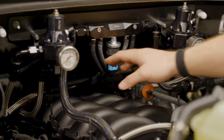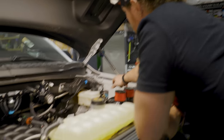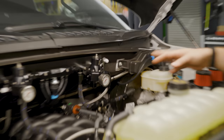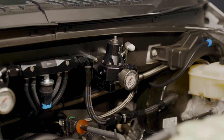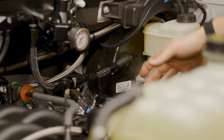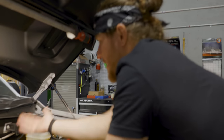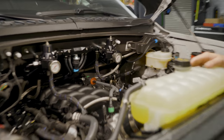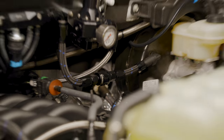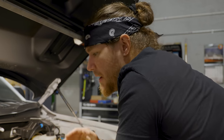On our vacuum block, we're coming out through a 10AN feed into here, which feeds all our reference points. We've got one hidden over here for a dyno reference, a couple feeding our boost solenoid, and another feeding some other miscellaneous vacuum lines. Coming out of the other side it slopes back down, and since we have a brake booster you can't pressurize that can too much without issues. So we have a vibrant check valve to regulate and make sure all of our boost stays where we want it and doesn't continue on to that booster — brakes will be fine.